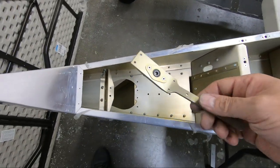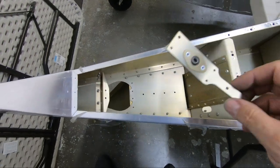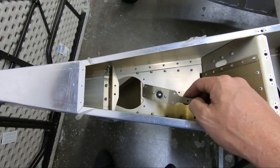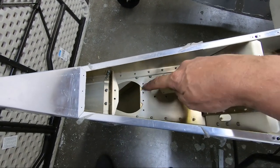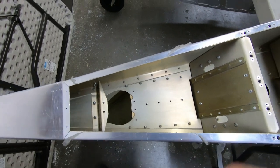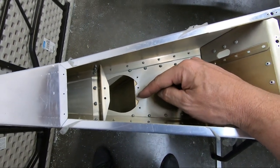What I want to focus on is trying to get this installed. One of the things I had to figure out is how I was going to handle getting rivets into these four holes at the base of the vertical fin. The two end holes can just have eighth-inch pop rivets installed in them, which I can't install from the bottom, so I'll pop rivet those into place. In the center, they're supposed to be either a solid rivet or a bolt. The problem with solid rivets is there's no way to get a bucking bar behind here or a rivet squeezer in — the rivets are just a little too close to the fin. So I think I'm going to go the bolt route with a three-millimeter bolt, which is closest to an eighth inch, like a number 5.